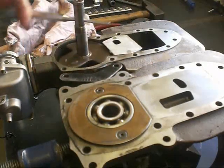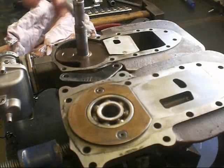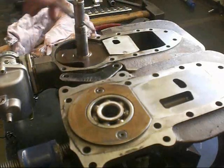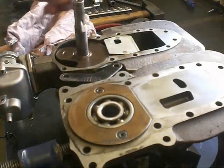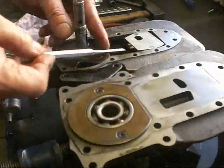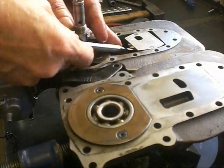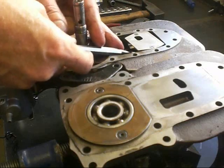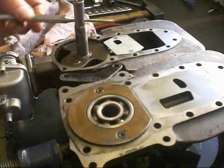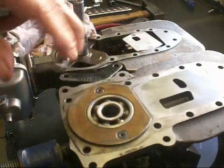So maybe the next step is to put it together and run it until it breaks. What is not visible here is that the piston crown is hollow and there is no weight where the gudgeon pin would normally be. So I consider the reciprocating mass here to be considerably less than a conventional piston.